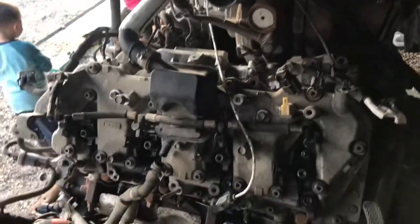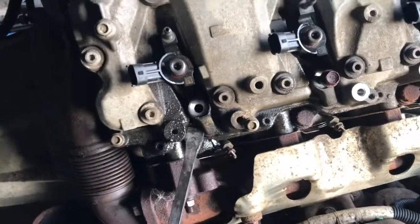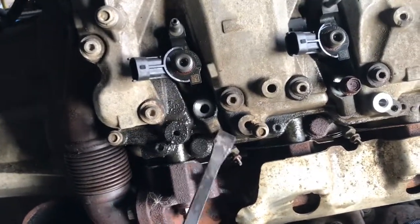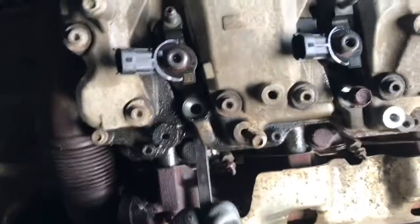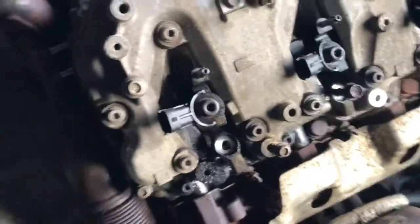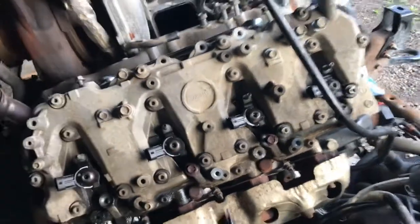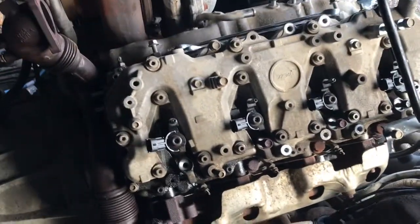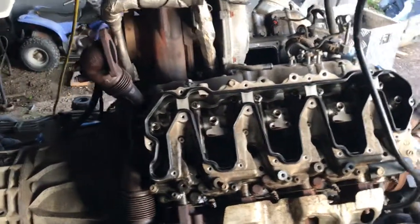The PCV system can come off now — finally. With injectors, once you get the bolt pulled out you just use this little hold-down piece, get your bar underneath, give it a little pry and up it comes — right out. As long as there's a spot for the bar when you get up on the other side, this passenger side is wide open. A little hook bar once you get up on the other side by the steering arm. So this side is wide open and they come out pretty easy.